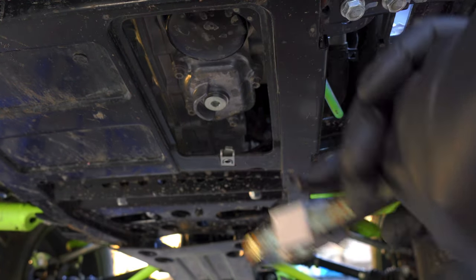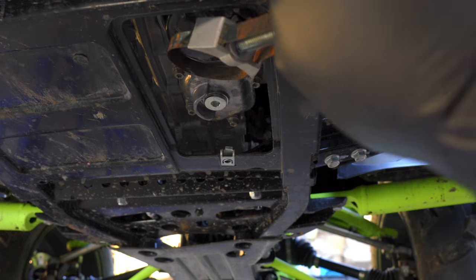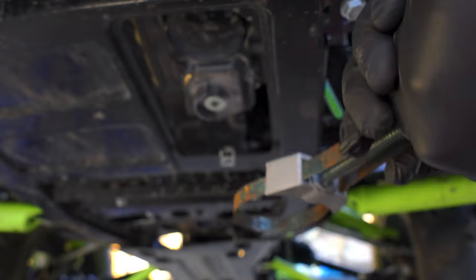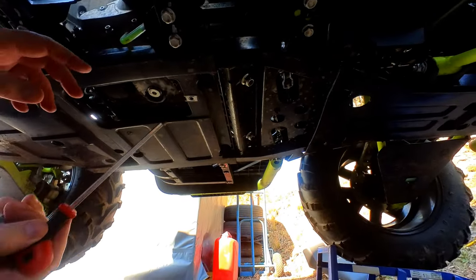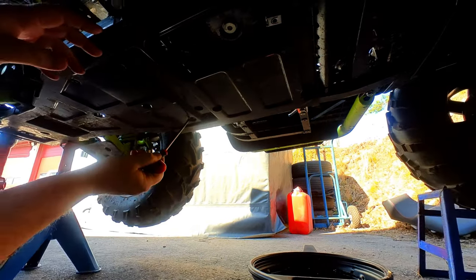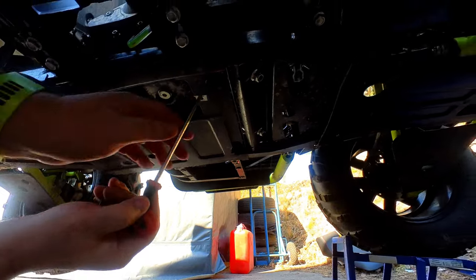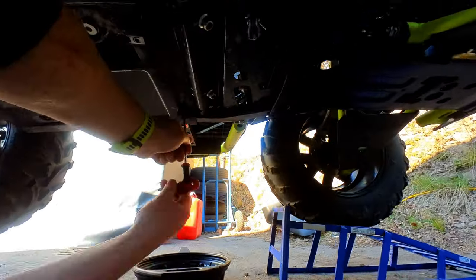To get this oil filter off, but there was just not room enough. So if I only had that tool that I'm going to mention. So I ended up unscrewing the bottom plastic plate. It's held up by four screws, 5mm hex key, so actually no problem.